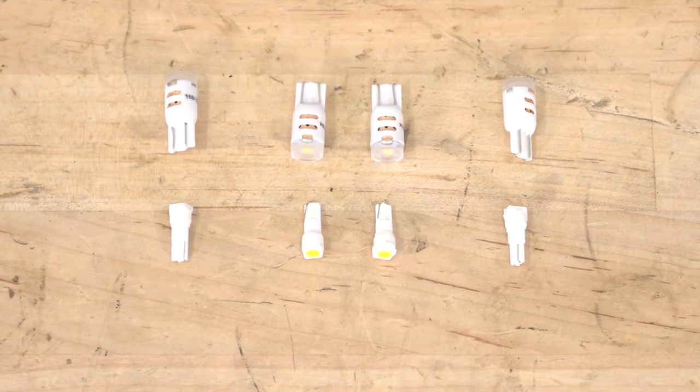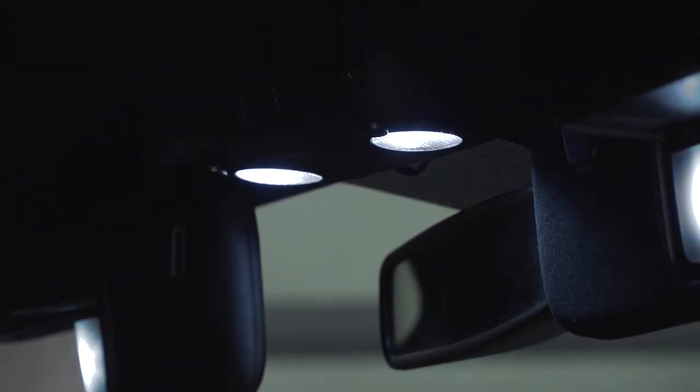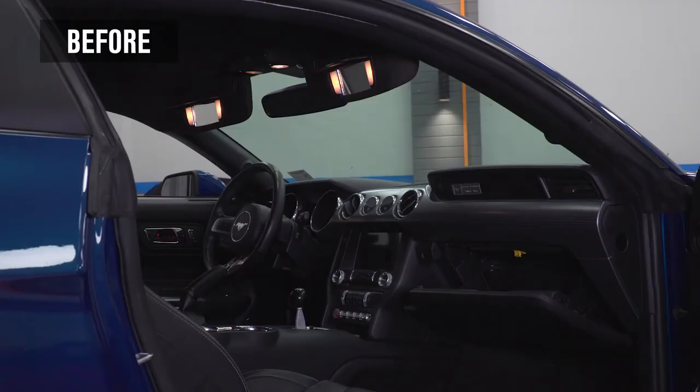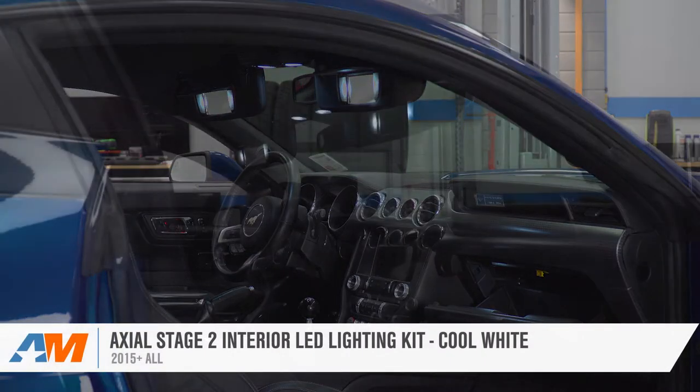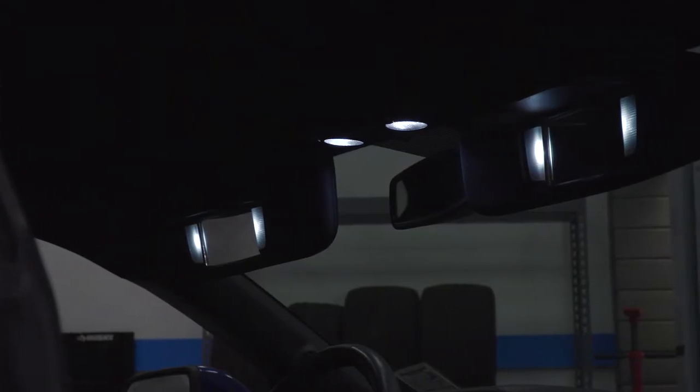The main reason for that drastic improvement is the HP5 style diode, which is a step up over the HP3 style found in Axial's Stage 1 kit, also available on the site. The HP5 will produce a total of 95 lumens each. When you compare that to the factory incandescent bulb and their weak 35 lumens, you can really see why these will be a better performing option, as you are essentially more than doubling your output while also providing a more uniform distribution throughout the interior.